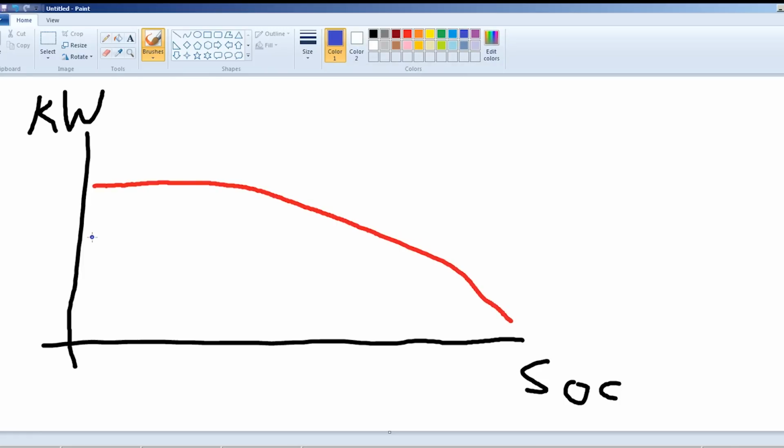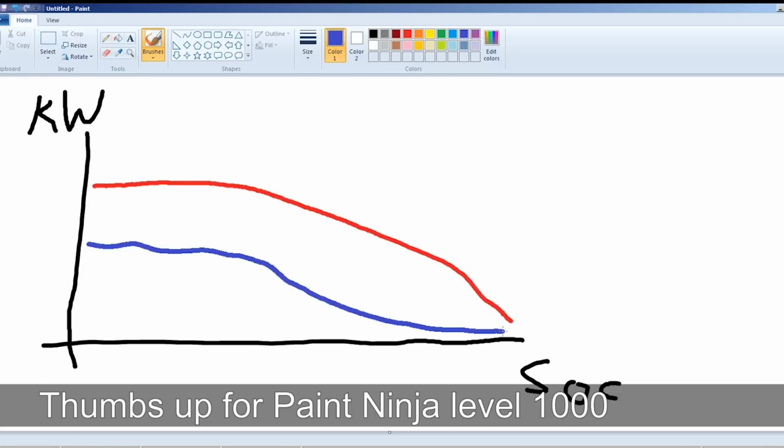But then the inverse snowball effect, the worst effect, is that if the battery is cold, then what you saw at the Nebenes is that you still gain percentage, but you charge so slow, and that slow charging doesn't build up enough heat. The charging curve for this car is fairly flat, but when the battery is cold, it drops faster than usual. So hopefully this explains some of the questions you have about why your car is charging slow and all that stuff.